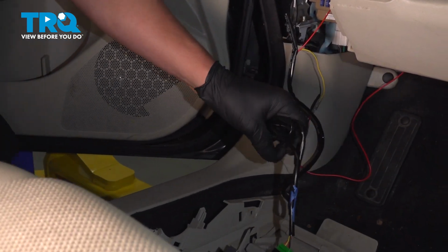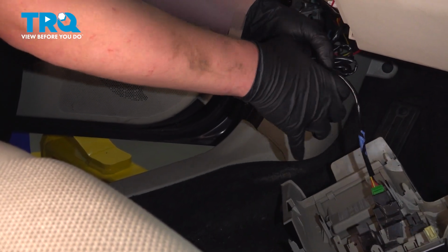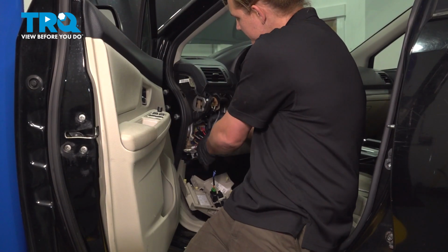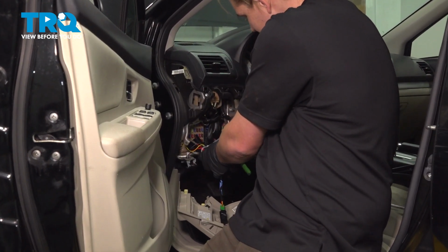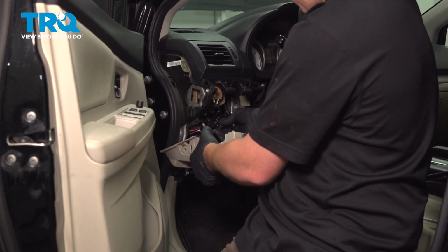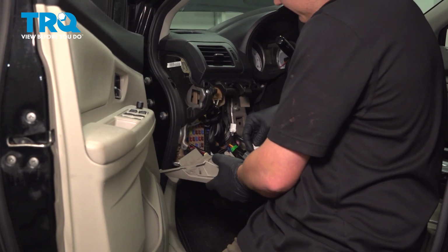We're going to grab all of our wires, clean them up, and put a tie wrap around them. We're going to put these wires behind this accessory panel after they're all tied up, and then reinstall the accessory panel. Grab all your wires, wrap them in a zip tie, cut the little end off, it'll get tucked up in there. Grab the harness and plug in your connectors.